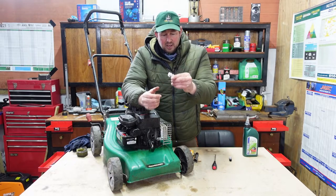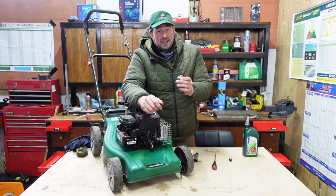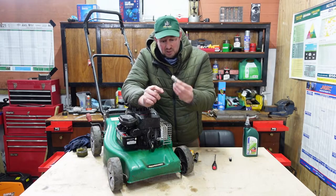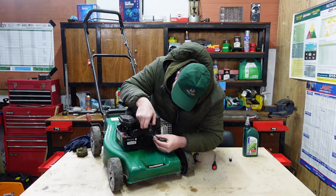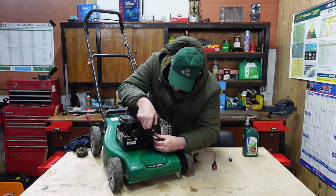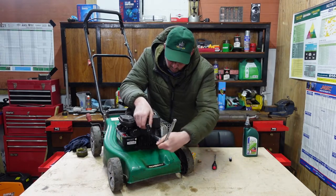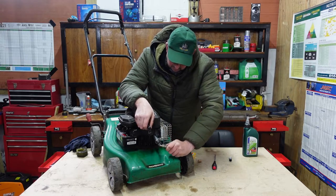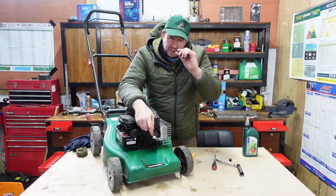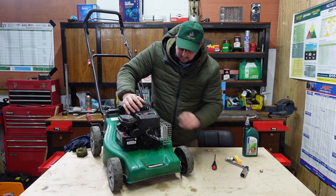Now to put these in, you just screw them in as normal. People think you might have to put some grease or oil on it — you don't. It does get hot in there and it can sort of warp the thread slightly. However, on these NGK plugs, they're shiny because there's a special coating that acts as a lubricant when we put them in. I'll just lean over and put that in nice and steady — there's no need to rush this job because you want to get it screwed in properly. Now that's finger tight. With it being finger tight, we then put the spanner on and go about a quarter to a half turn — no more than that. You want to make a good seal, just push that washer down slightly, but there's no need to over-tighten and damage things inside. So that's the spark plug done.